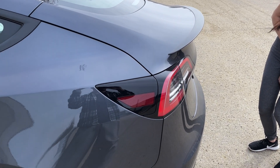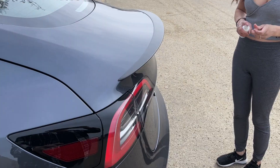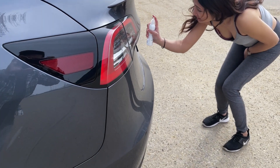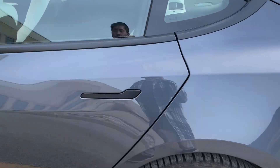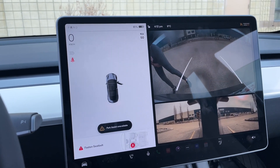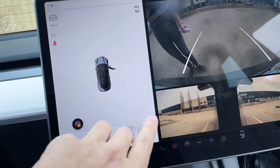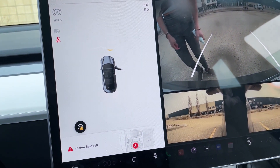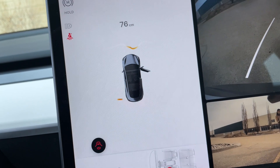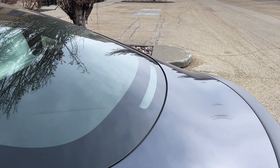Most of you probably want to see the rain situation — what it's like if the camera gets blurred by rain. We'll imitate that with a little spray of water right underneath the camera bumper. It doesn't seem that effective at first, but if you start spraying it too much, it's going to say 'parking unavailable.' I think this is what a lot of people were saying — as soon as it starts to rain, park assist goes unavailable.